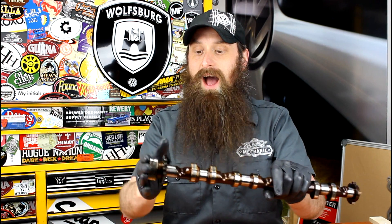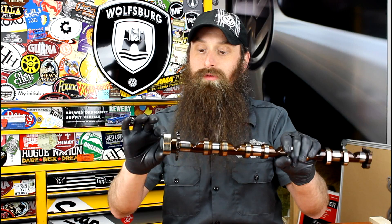So what does all this do? This is the intake camshaft. This opens and closes the intake valves, and also has the cam position sensor on one end. On the opposite end, it has the lobes for the high pressure fuel pump. Because direct injection requires such high fuel pressure, Volkswagen had to add a mechanical pump in addition to the electric fuel pump in the tank. So the electric pump pumps fuel up to the engine, while this guy creates the high pressure fuel for the direct injection system.